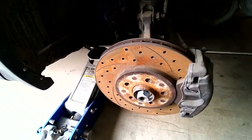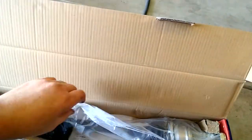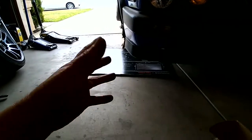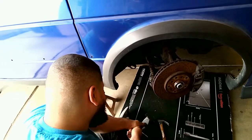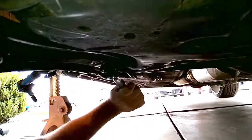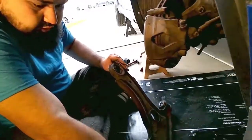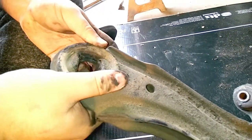We've got a new driveshaft right here. We're going to grease everything - it's got a new nut, that's good. We're gonna go ahead and remove the shaft after we remove everything so it's out of the way and we can simply install the new one. We'll remove the bolts so we can take the wishbone out, then we're going to use the press to press out the bushing. That's all we're going to do and then put it all back together.